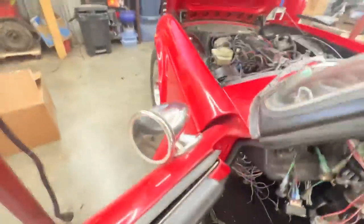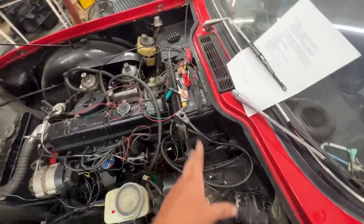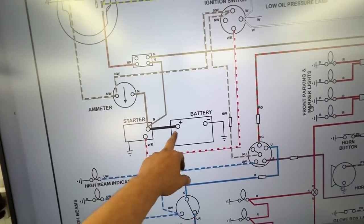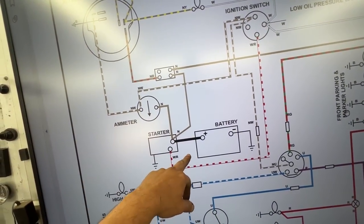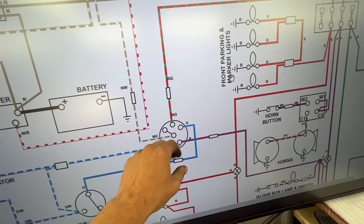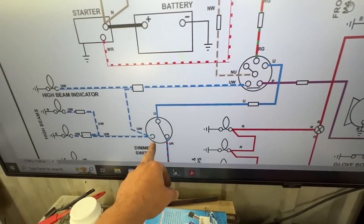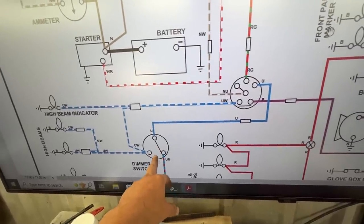What we're gonna do is, for now I don't have any fuses, so I'm just gonna connect the ground — and that's gonna power up the brown circuit, because the brown circuit apparently is the one that is not fused. From the battery it goes to the starter, from the starter it goes to the ammeter, from there to the alternator — so this is how you charge the battery. Through the ammeter you have power to the ignition switch, and from the ignition switch it goes to the light switch.